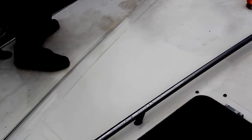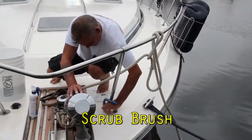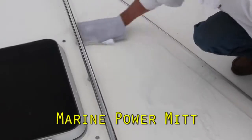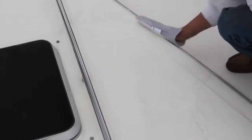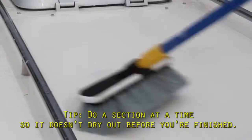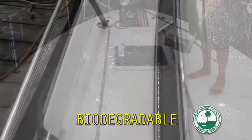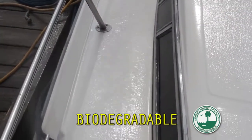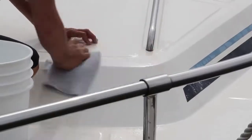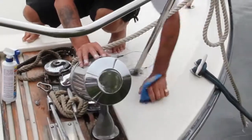Getting this deck clean will be fairly quick and straightforward now. We'll use a deck brush for large areas, a scrub brush for tighter areas, and a marine power mitt for the smooth surfaces. First wash the deck with Boat Clean Plus. Apply some Boat Scrub and give it a good scrubbing. Now rinse everything clean. These products are biodegradable so they won't hurt the lake or the fish. Check the surface for remaining marks or stains and use a 50-50 solution of Boat Clean Plus and Boat Scrub to rub them out.